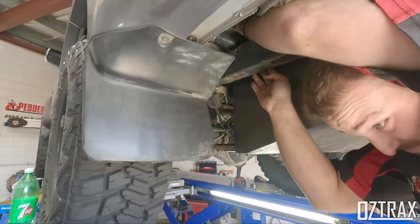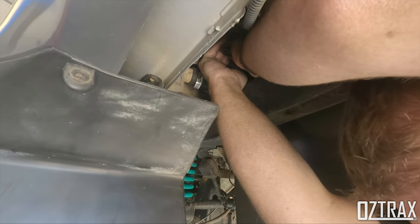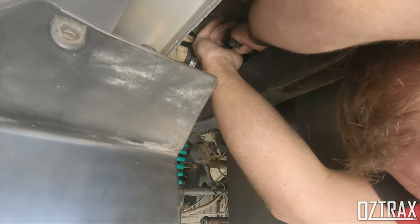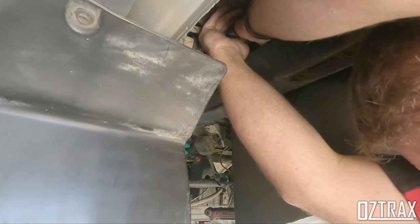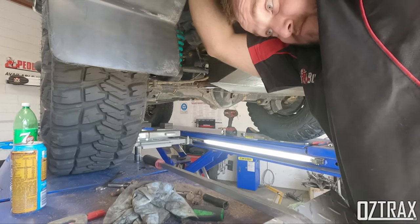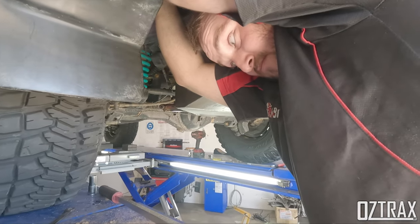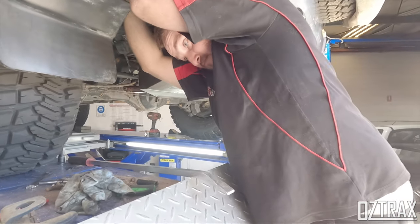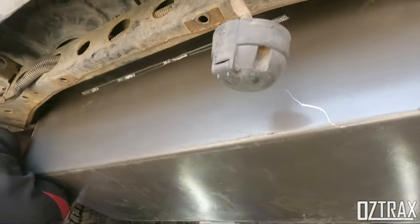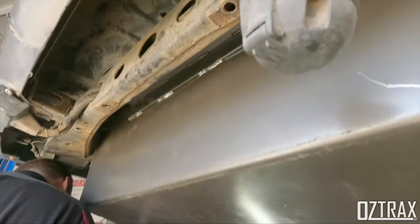So just getting in here now. Right up in there, a bit fiddly. Just put some new hose clamps on. What do we have to do? So we pretty much have to shorten the main filler hose 25mm and the breather hose 50mm. Then you've got to try and get the brackets in. We had to take the tow bar off in the end to get this to go in because it wouldn't go in. So you've got the mounting bolts up there.